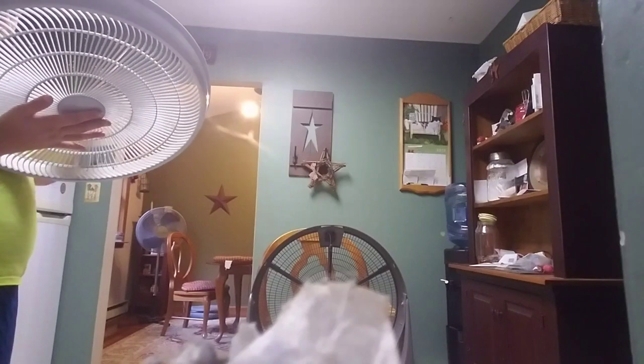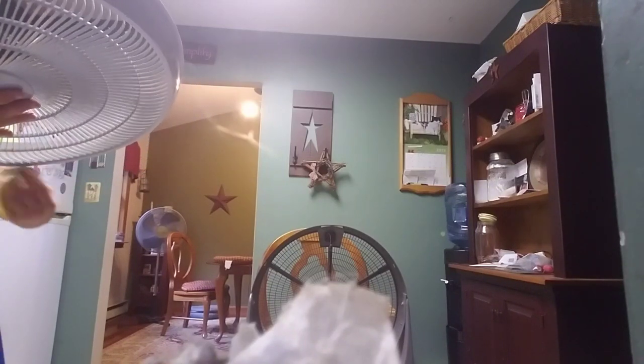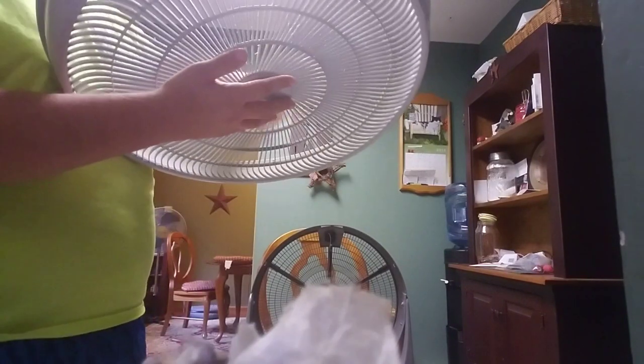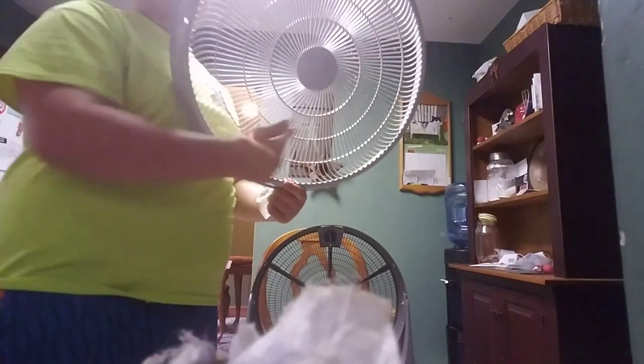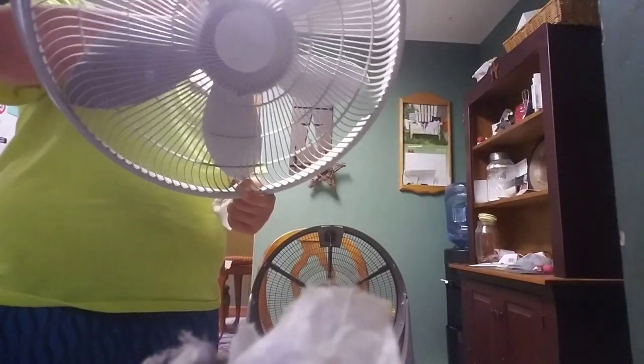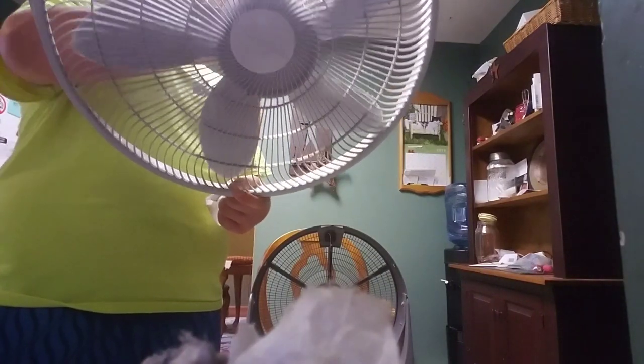These covers are meant as a protector, but what they mostly do — and I've noticed it — is they capture a lot of the dust and allergens. And the little slats — on newer fans they're facing a certain direction. On this one it's in the opposite direction: the fan spins this way and the slats are going the other way. So what it does is catch the dust as it spins while still allowing the airflow, which I think is a pretty cool idea.